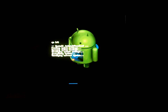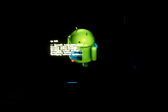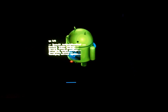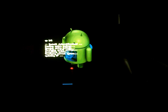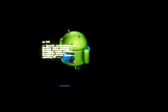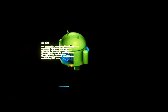The reason we used Voodoo OTA Root Keeper is because this update will remove root access, but using Voodoo we will restore it. If Voodoo does not restore it correctly, there is a zip file you can flash to restore root, which I'll show you. We're about a third of the way across the progress bar. Now, once you do this update there's no going back to Ice Cream Sandwich - only moving forward.